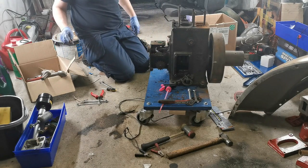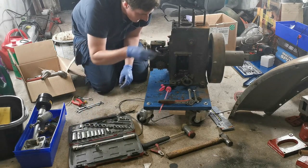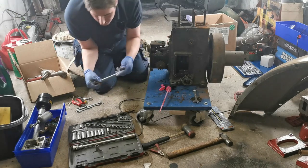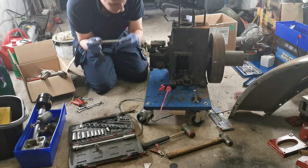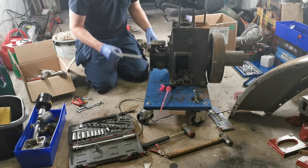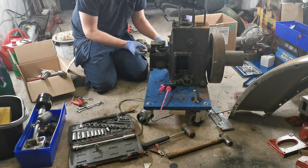So, right, let's see now. Finding a suitable size socket for bleeding Whitworth, bleeding tools. It's wrecking my head, to be honest, which is the one thing about this whole operation I'm not enjoying: Whitworth. So, anyway. That's 13. And that's 12. 12 would be too tight in 13. Oh, 12 fits. Well, that is the thing. What size it actually is in Whitworth, I have no idea. I can tell you that 12 would be probably somewhere between 7/16 and a half in the AF measurements. But I have a decent set of AF tools. As I said, I am an aircraft mechanic.